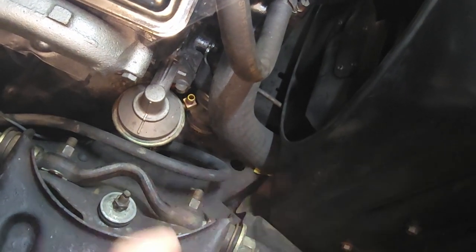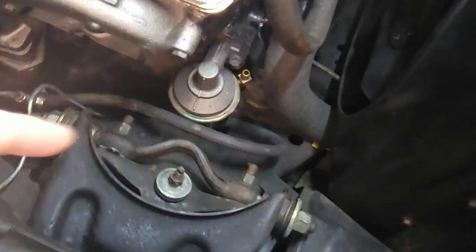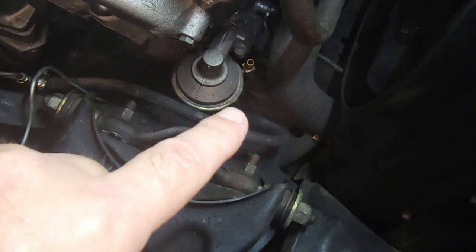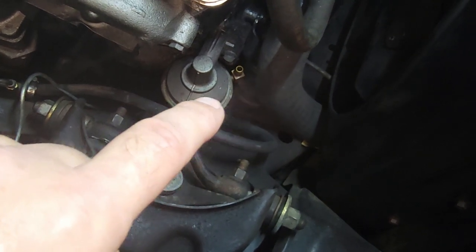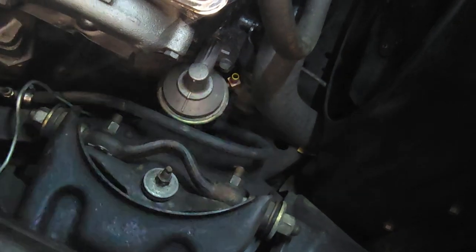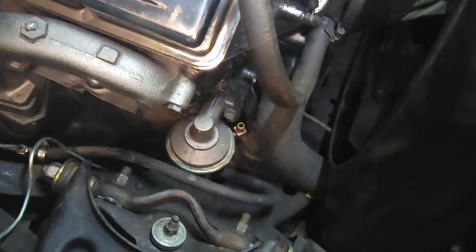Not really. So, on a Trifive Chevy, usually you have the fuel inlet on this side and the fuel outlet about here. Well, my new one doesn't really have that. So I clocked it to be outlet here, and then the inlet's going to be about here, and I'll put an elbow on it so I can just run this straight into it. That's what I'm planning to do, but I need to get this one out first.